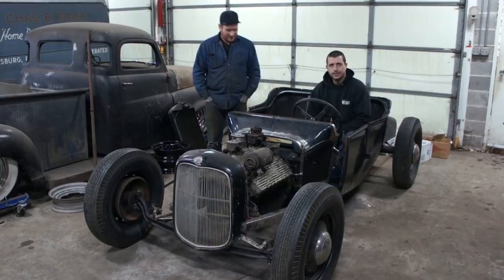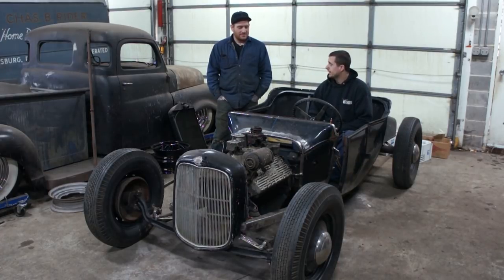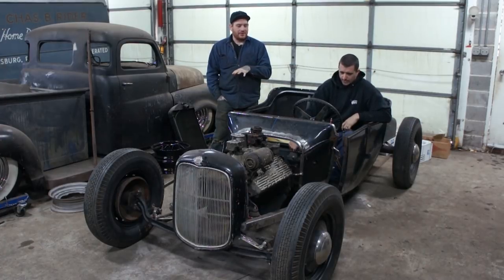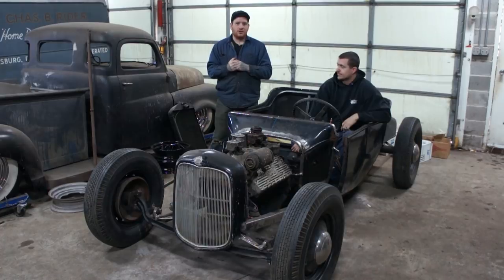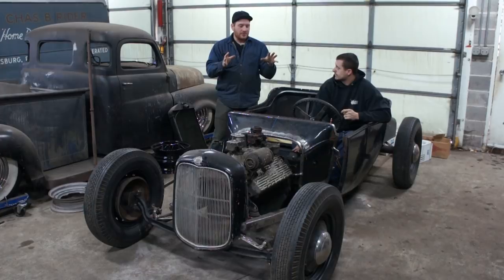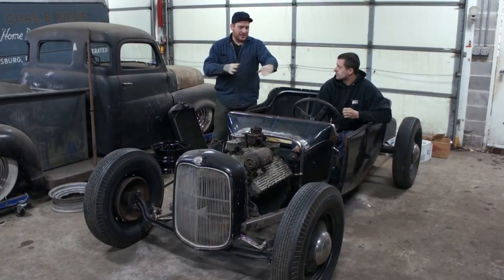I had to leave last week a little early to do some family stuff. Matt got this tacked into place and bolted up, and it's starting to actually look like a steering box setup. It's kind of nice to sit here and make noises and actually be able to turn a wheel. We got it tacked into place, we got the angle right. We were going to do the whole video of the process in one video, but it would turn into an hour-long video — you don't realize the amount of time and work that goes into something like this. It might be a 45-minute video, but it took us like three days of work. We're at a good stopping point where you can see where the column's at, and the wheel is kind of at a good position — we can adjust how far back it is for arm position.